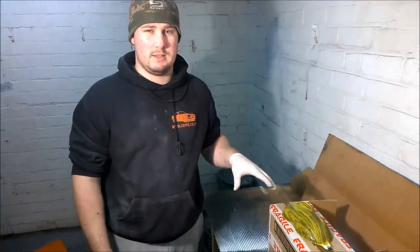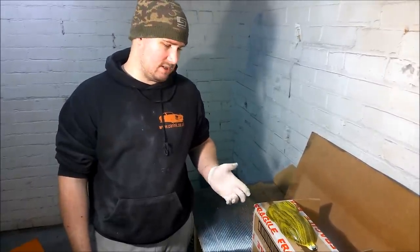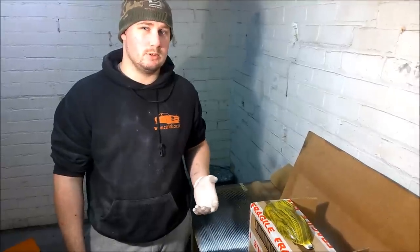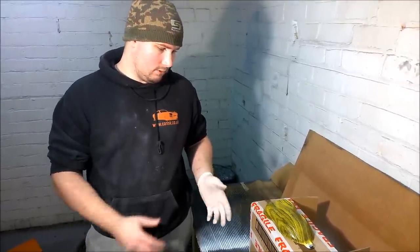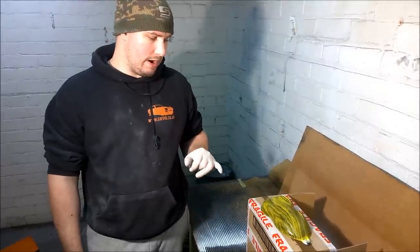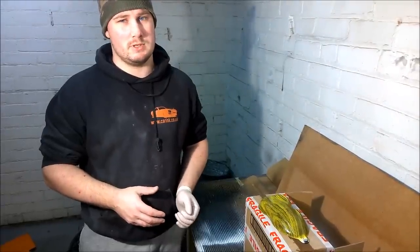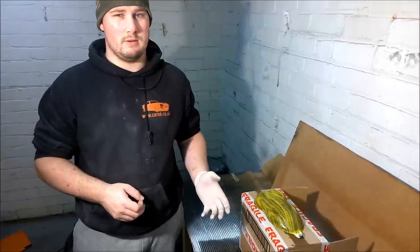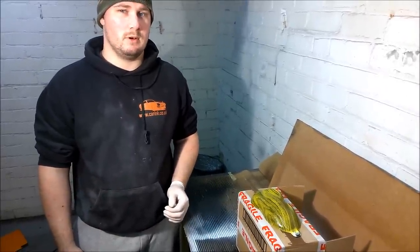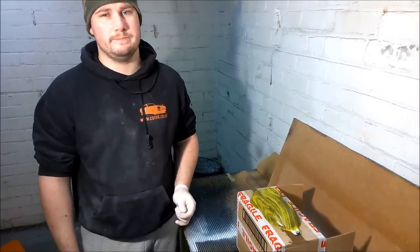So that's it with the final lacquer coat — no need to apply any more lacquer now. You can leave that to dry overnight, or leave it under a warm lamp and it'll dry in about 30 minutes. Don't get too close or you'll burn it. Once it's dry, it's done — you can put your part back on whatever you've taken it off and start using it. Bear in mind lacquer can take up to a month before it goes absolutely rock solid and becomes more scratch resistant. If you need to sand and polish it, wait three or four days until it's gone off quite a bit. If you need any help, look us up or give us a call. Thank you.